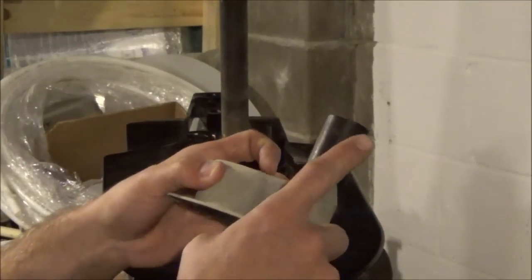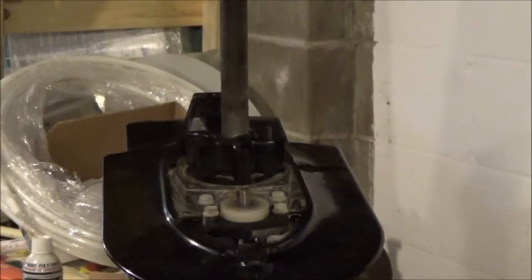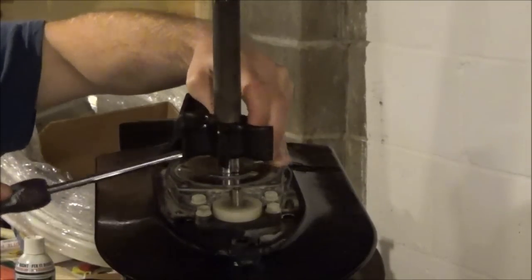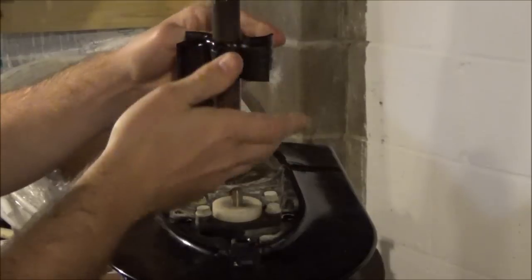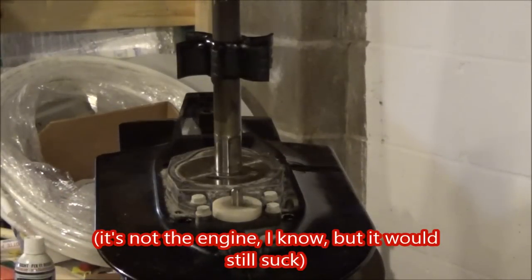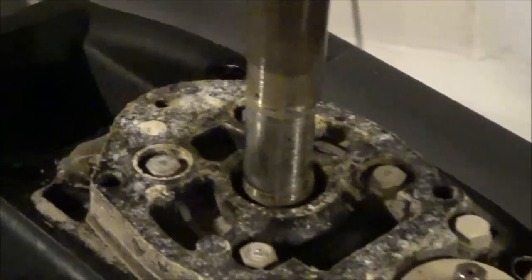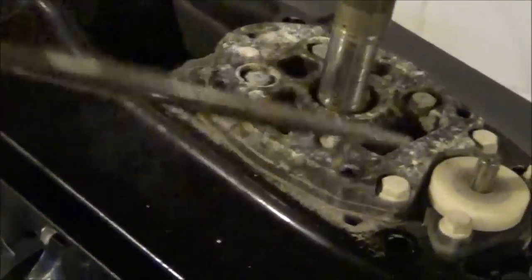I did have to fish the water tube seal out of the top part of the shaft, just above this. It's just taking a little help — that thing does not want to come off. Keyway — where is the key? I feel like if that dropped down in the engine that would be bad. This is a Mercury impeller, part number 47-43026. There is the top of the housing and I'm going to have to clean that up. That just looks bad.